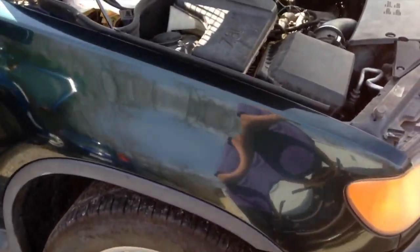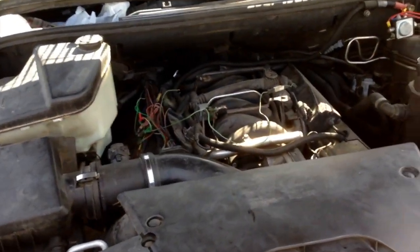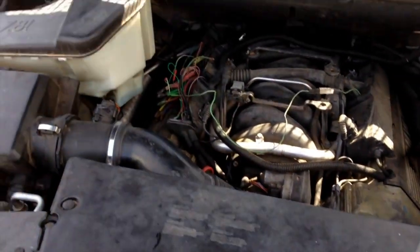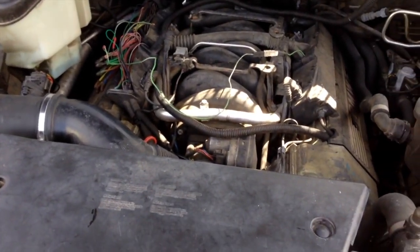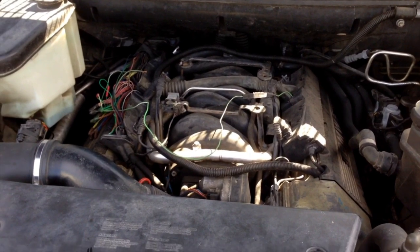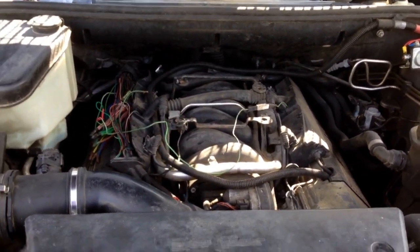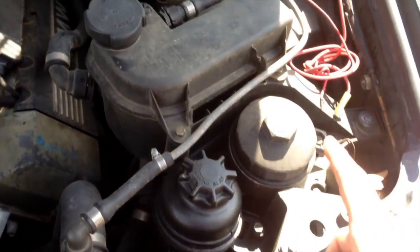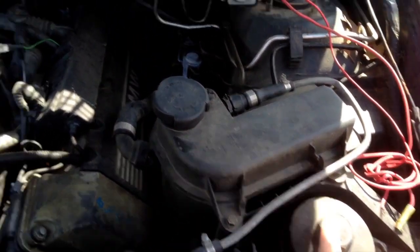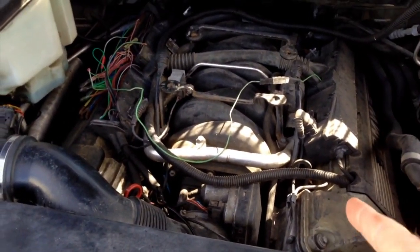When it started up it sounded rough. It's been sitting for quite a while — I don't know if it's just the timing chain tensioner that hadn't pumped up yet. It's been sitting here overnight so we're at a dead cold start right now. We're going to start it up and see how it sounds. I definitely want to pull out the oil filter and check for any fragments of timing chain guides — right now we're at a 75% chance we need to do the guides in this thing.